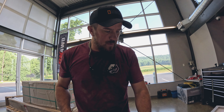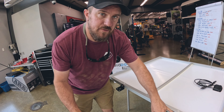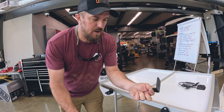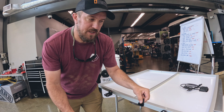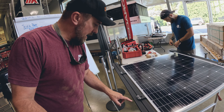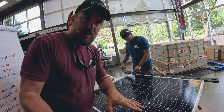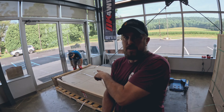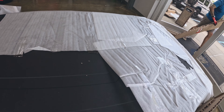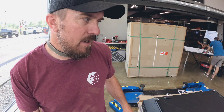These are the GP solar panel mounts. We're going to drill through each side in two different places — it basically gets a rubber isolator, carriage bolt, lock nut, and a washer, then this plate will rest on top of the load bars on the mod cap. Four bolts for each track with lock nuts and washers. We're going to pre-center this so it'll be ready to just put on the mod cap. This is the tent that's going to go on top.